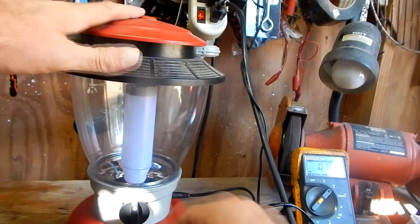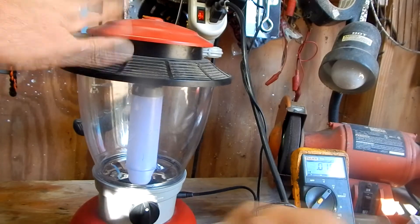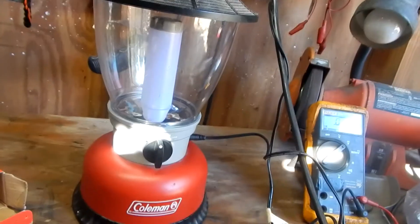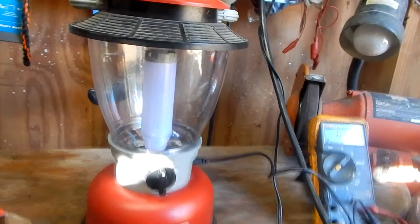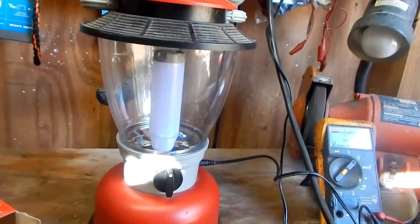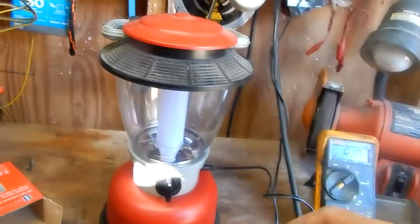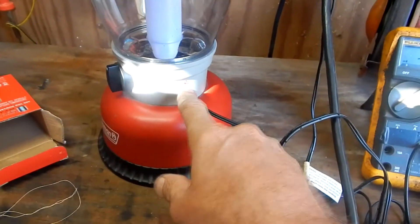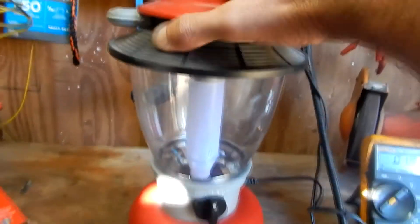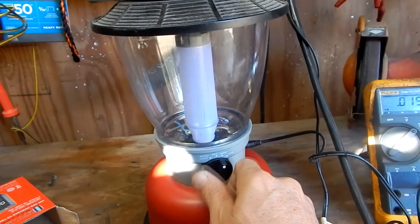Now for the big thing — I want to put my charger in and see if I get a charging light, and I do. When you're charging that brand new battery, monitor it closely and put it somewhere safe. Some batteries aren't compatible with other chargers — they could overheat, catch on fire, blow up. That's another reason you've got to make sure you have the polarity of those wires all hooked up right, because if you cross them it could cause an explosion or ruin the battery. Make sure you verify those wires before you hook them up.